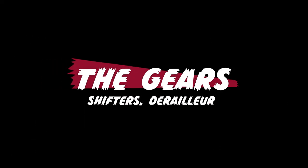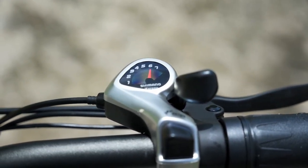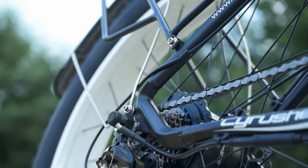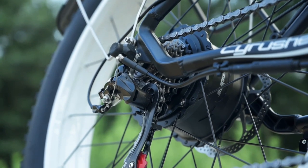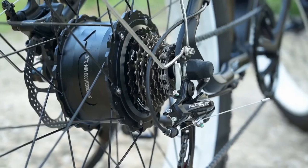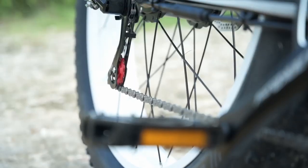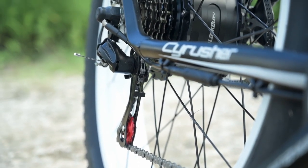Next, let's talk about the gears. The XF650 is a 7-speed. We have a 7-speed Shimano SIS Index Shifter on the right-hand side — you guys know I'm a big fan of those — connected back to a Shimano Tourney derailleur. Right out of the box we didn't have to do any adjustments. There was a little bit of a rough shift between 6 and 7, but everything else was very smooth out of the box.